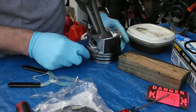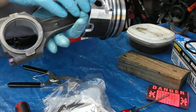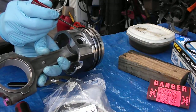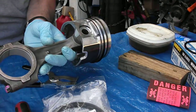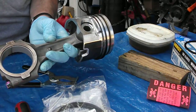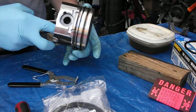You just got to make sure that that second very thin ring that comes with the kit is absolutely seated in. There's the original machine surface, there's one side of the gap, and here's the other side. You've got to make sure that all the way around the whole piston, that little thin ring is actually engaged and riding in that flange. It's hard for it not to be when you get it installed properly, and it's hard for it to actually come out of that flanged area because there's only enough room in the piston ring groove for it to fit properly.